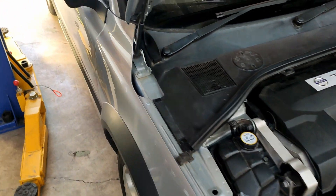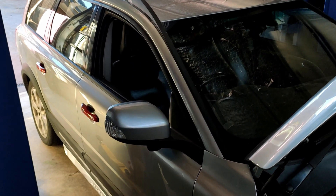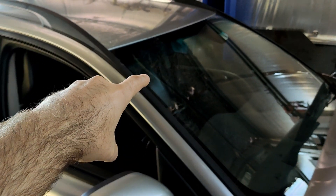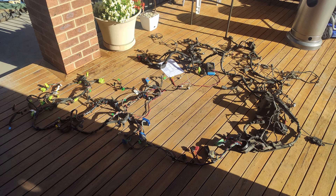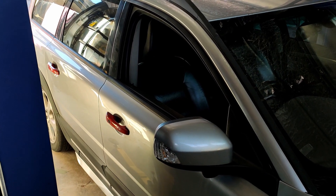In addition to that, I actually changed pretty much every single wire in this car. Your main body harness runs in a big loop around the car — comes from your central electronics module, runs right down that side to another fuse panel at the back, and then loops back around and comes back up this side. So there's a full loop of wiring. I'll splice a couple of photos in here for you to have a look at just how I did that.